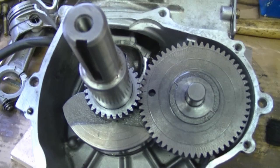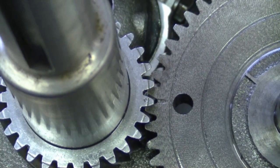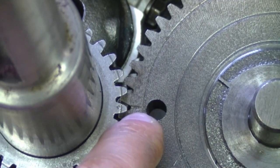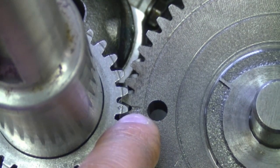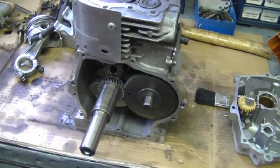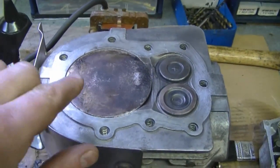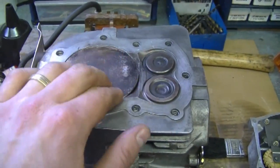I've turned the motor over and the marks are perfectly aligned, and that's exactly what you want. Like I mentioned previously, if these marks don't align when you turn the motor over, your engine is never going to run properly. And usually when you have the marks lined up properly like that, your engine is going to be at top dead center — meaning the piston is at the very top and both valves are going to be closed.